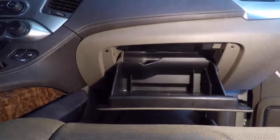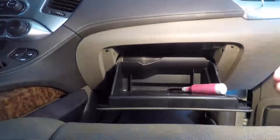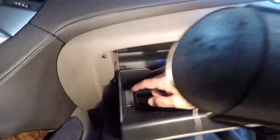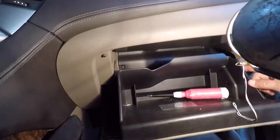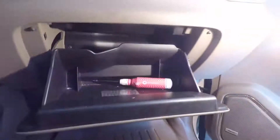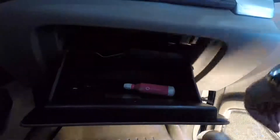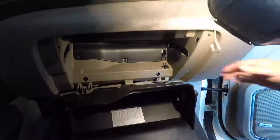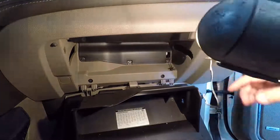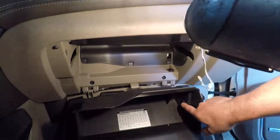We're almost done our little maintenance work here. Now we're going to change the cabin air filter. Pull in on each side of the glove box and pull that down. You can see a couple of little strings here — take that off and hopefully that'll get the glove box to flop down properly. It's on a recoil thing — you don't take the string off, you just take it out of this little hole.